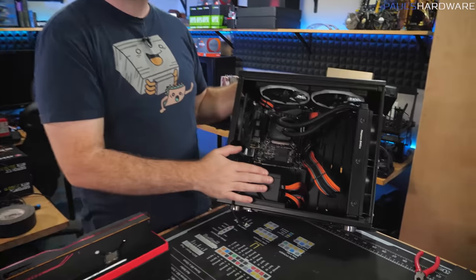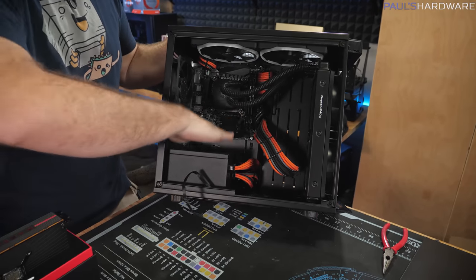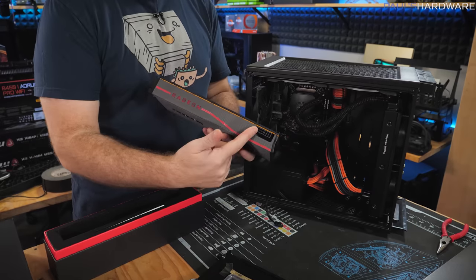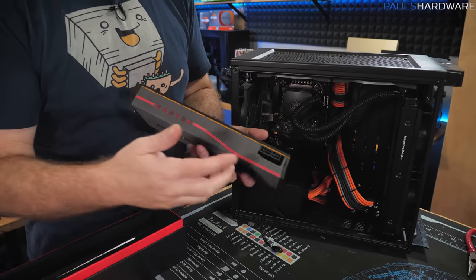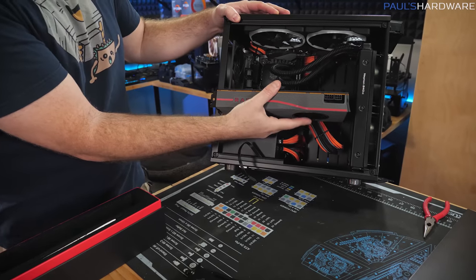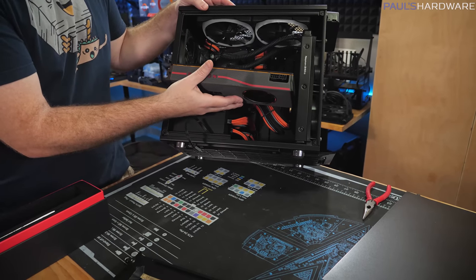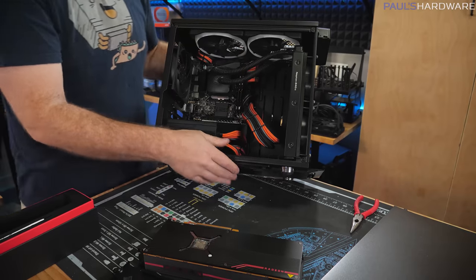I was more concerned about getting the graphics card set up. I decided I wanted a graphics card that was air-cooled, since we no longer have an open loop in here to connect a liquid-cooled graphics card to. I want one that ideally has two 8-pin power connectors, because I have these special pre-sleeved cables made by Insourced Customs, and I want to keep using those as-is. And then finally I wanted one that's two slots, because one of the downsides to this case is that if you install a full-size power supply, you really only have those two slots for the graphics card. So a couple benefits to going with the 5700 XT reference design — it's at least an 8-pin and a 6-pin side by side, and the blower style cooler means the fan will be suspended over the open area so it will have space to suck in air.